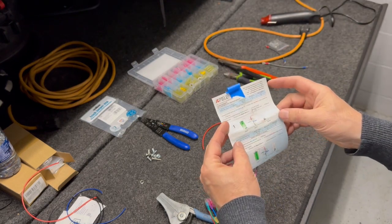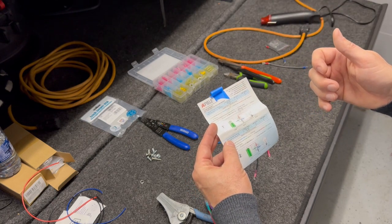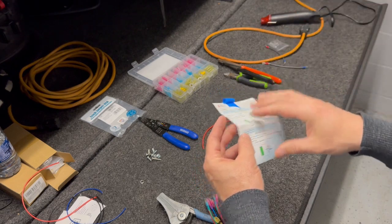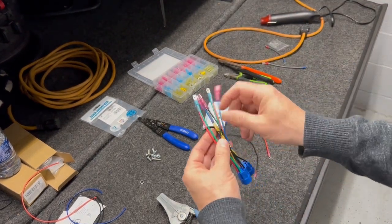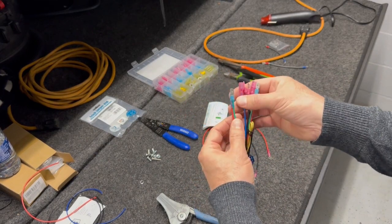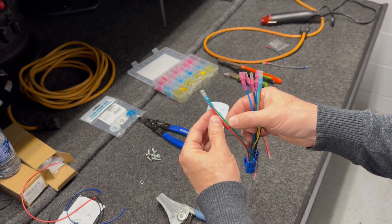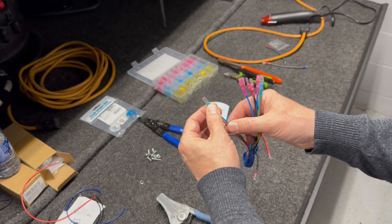What I chose is that when I turn the key on and the switch receives power in ready stance, if you will, that little LED light circle comes on, which I think is selection number 3. So back when I originally put this in, I tied the yellow together. So to do it in that format, we've got the green and the red into one. This will go to the fuse panel.